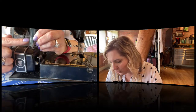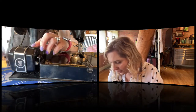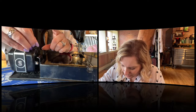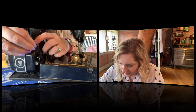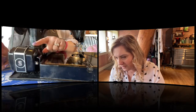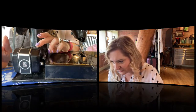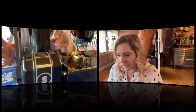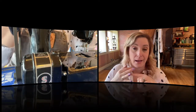You want to make sure that you have at least a quarter inch of carbon brush left on your brush. We also resell replacement brushes, so that is not a big deal. If they're less than a quarter of an inch, you need new carbon brushes. As a technician, I would never change the top and not change the bottom at the same time, so you can just do a quick inspection from the top.